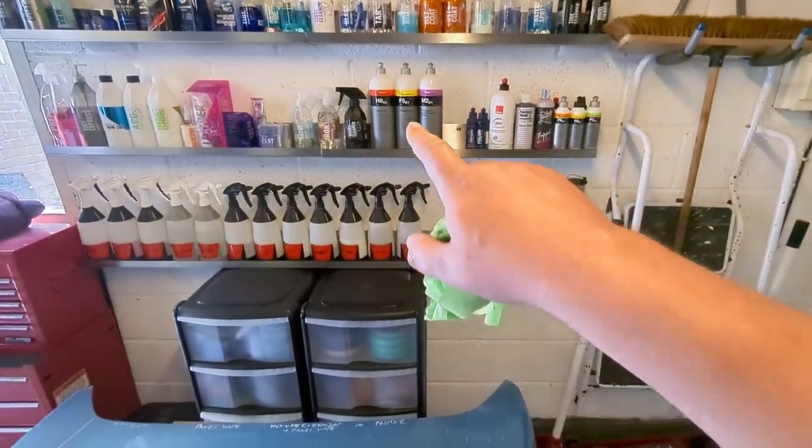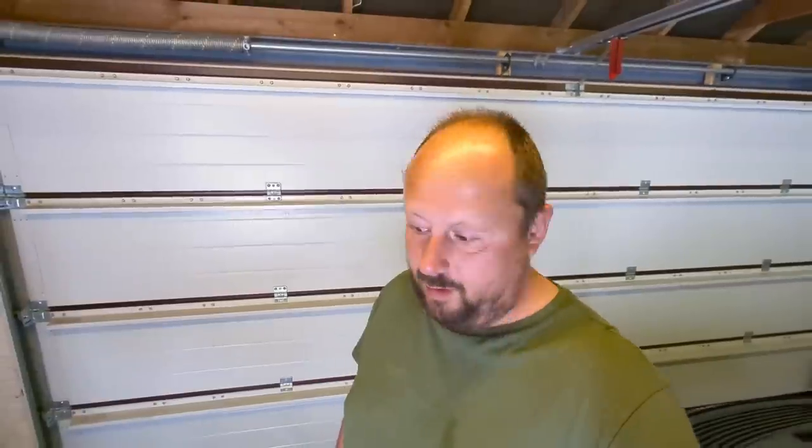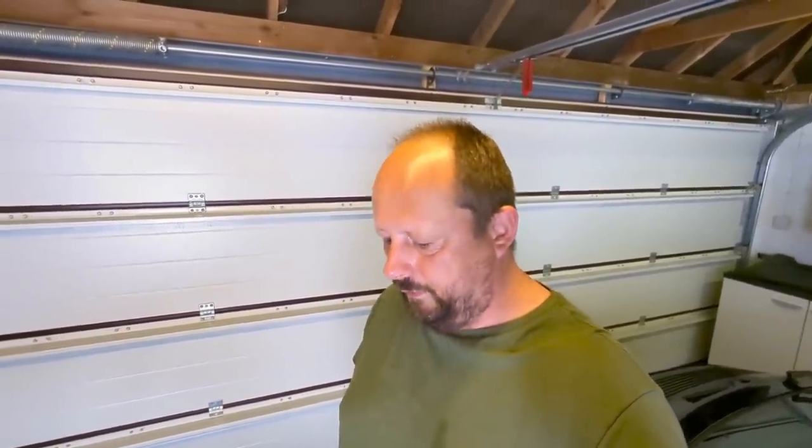If you've got a really good polish that you've used to do your cutting, like even H8 or a low cut F5 or something, they can gloss up really nicely. But when you've got really good lighting and on black paint, if you do skimp on the finishing, sometimes you can spot where you've skimped, and that's not a nice feeling.